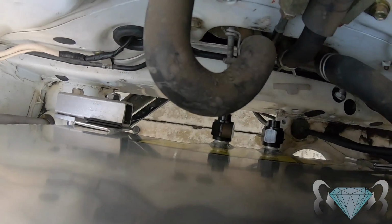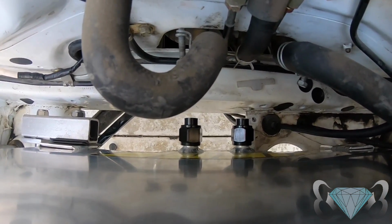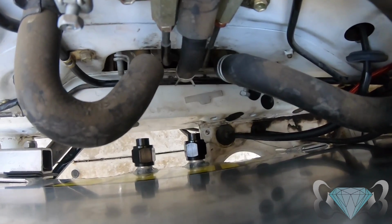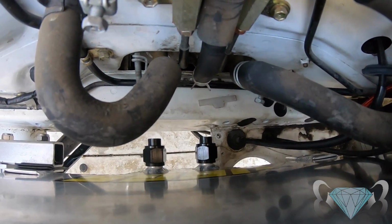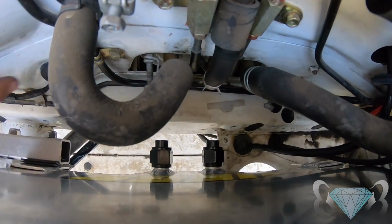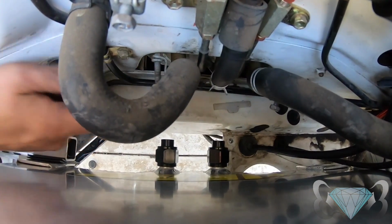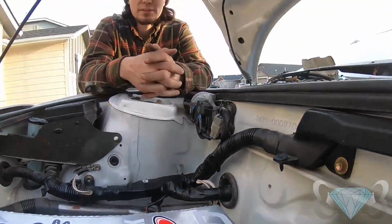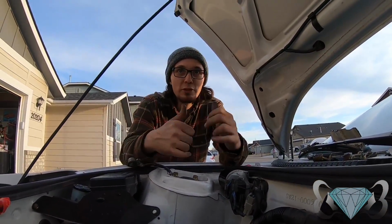The fuel line fittings, I need to get like a 30-degree or 45-degree AN fitting because it's pretty tight back there. And that'll shoot it straight into that hole with your coolant lines. Right, you can go down all the way back right in the middle. Yep. It's going to be muy bueno.